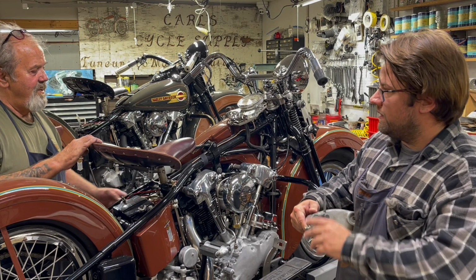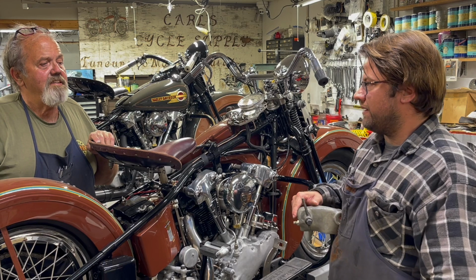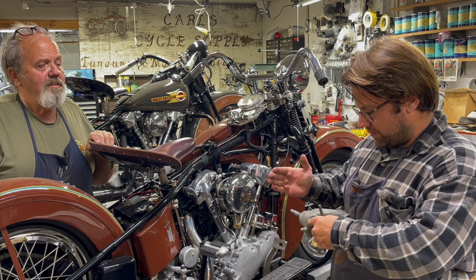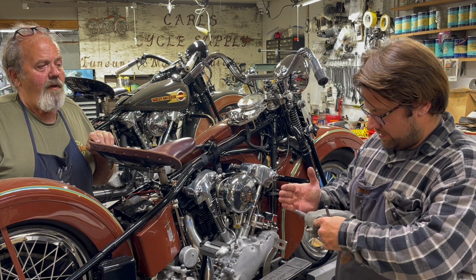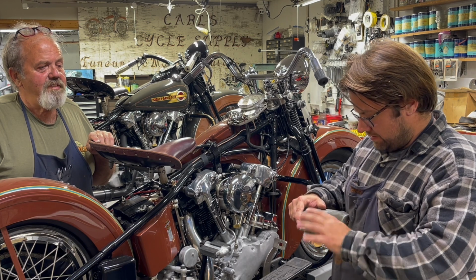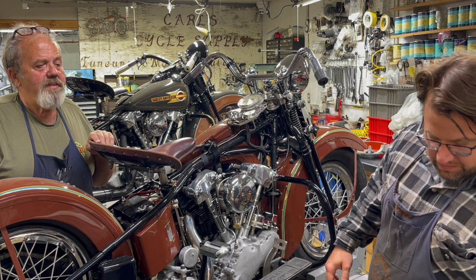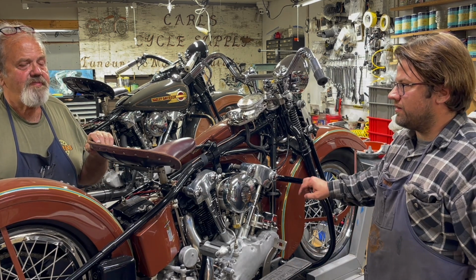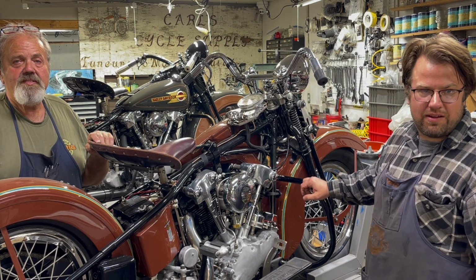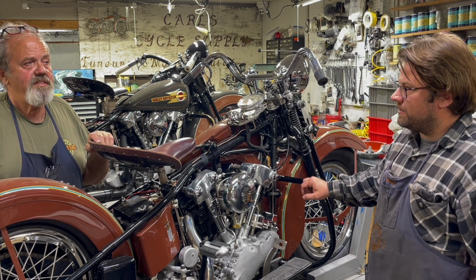One thing to mention, you want to loosen the jam nut on the other side after this is on. And then once you move it the quarter revolution, you tighten that nut, and then break this loose. And then put your brass washer and chrome nut back on, and then you go out and test it and see if you made it worse or better. And after messing with it enough, it kind of turns out. So we're going to take this off the lift and fire it up, and then you can see how it does.